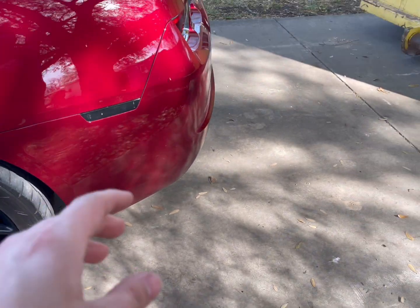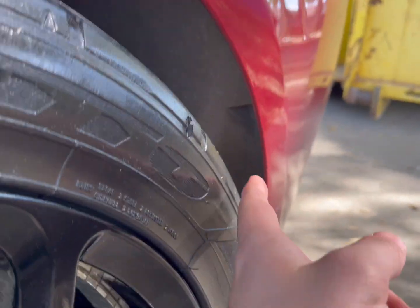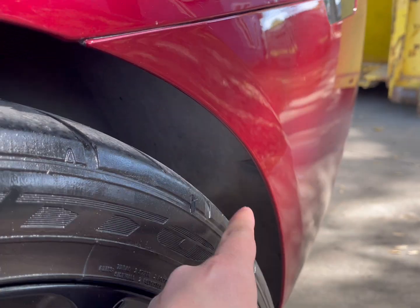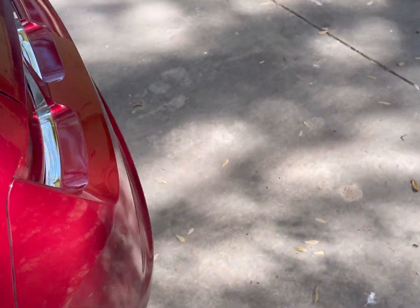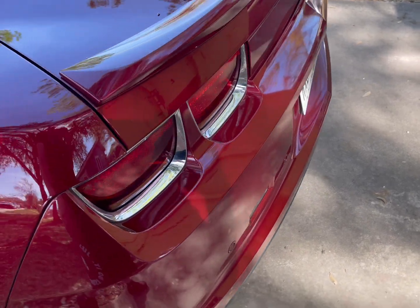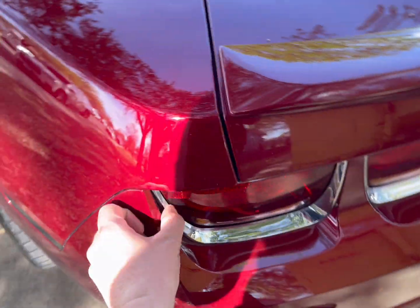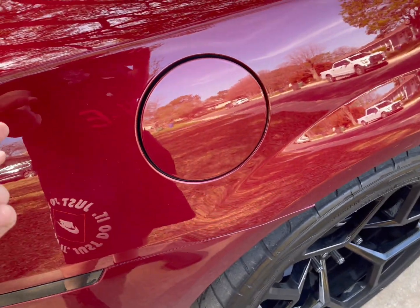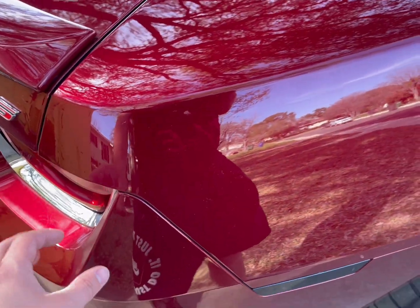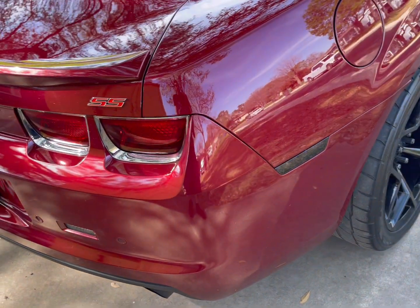What we're gonna need is a 7mm bolt right here — I've shown this on my last video. You're gonna need your T15 Torx bit to go and remove all three of these bolts back here. Now down here when you go to get it off, you're gonna do both sides. Pull right here, then walk to the other side and pull it off. Watch it simultaneously — you don't want to stretch one side without the other, so you can get it equally off.